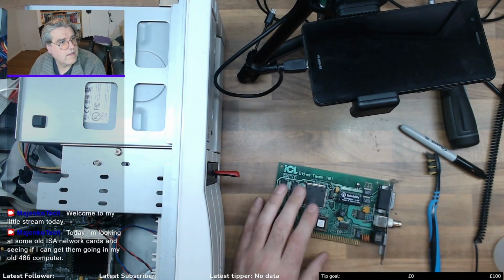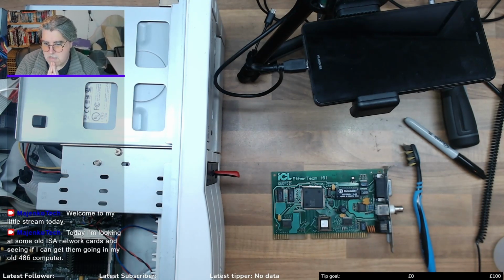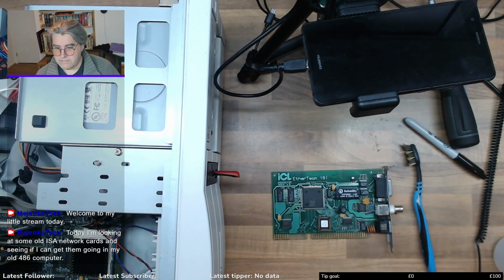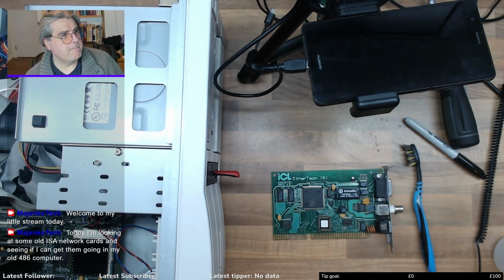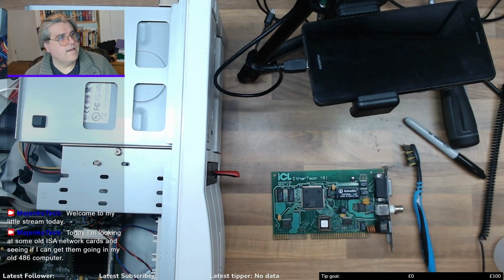Yes, I'm going to want to dump this boot ROM. Rather than using an actual EEPROM programmer, I'm sure I could just put it in the computer and read the EEPROM directly. So it'll just be sat there in the address space. And I'm sure the diag program would tell me where in the address space it is. And I can pull that off and stick it onto archive.org. Yeah, I think that's the way I'll go about that one.